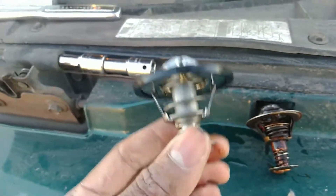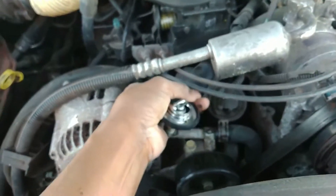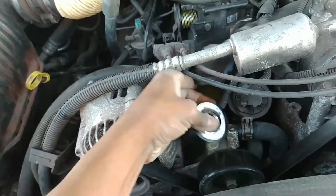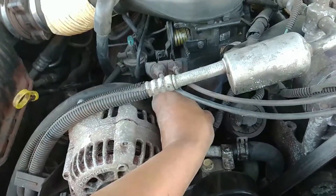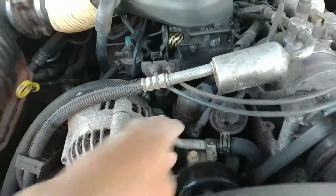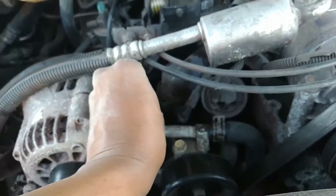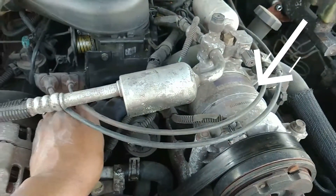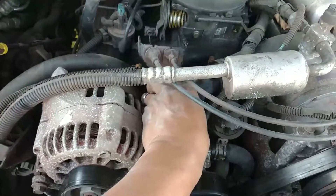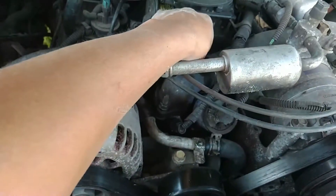So I'm going to put this back in where it belongs. Just lift that up out of the way — already got my bolts out. Plop it down in there. No gaskets required on this one because it has a rubber O-ring on the outside. Put your two studs back in; it's going to require a 13 millimeter socket — you want a deep well and a couple of extensions to reach around your AC compressor, components, and throttle cable assembly. Once you get those in, you'll be good to go.